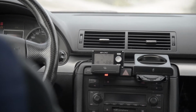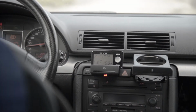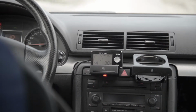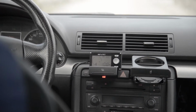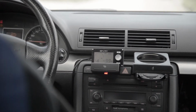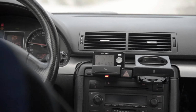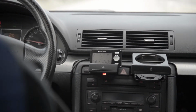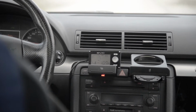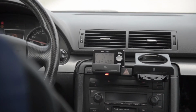So the max on that one was 18.5. I had it set to 17.5, which is pretty good. 1 psi off. I've just set it down to as low as it'll go right now, so I think it's 14 psi. So we'll see what that does. I've got the MAF unplugged right now, obviously, because I never got that problem fixed. But super low boost should be fine.